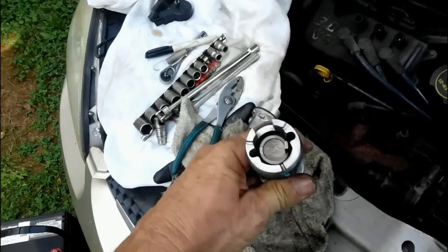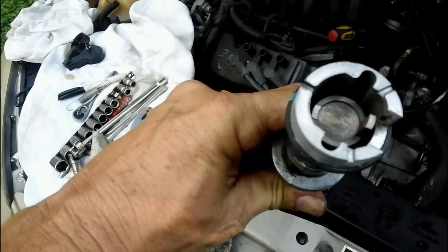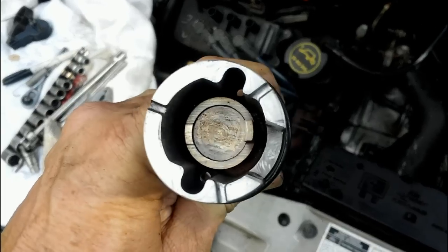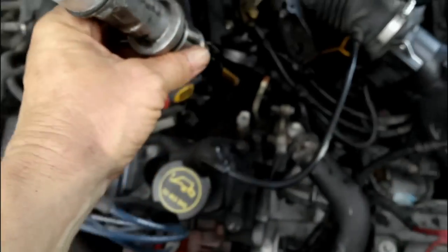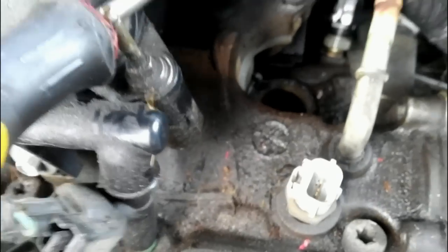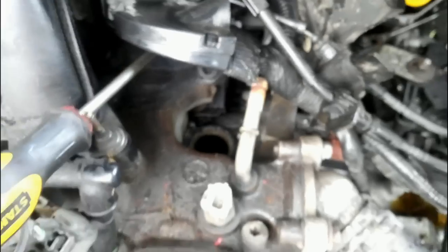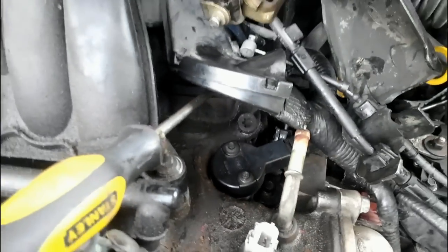I noticed when I put this one in, the mark — before I drop it down in there — right when I pulled this up out of there, that mark went to right about there. So when I push it in, it should slowly go back right about there, right where I want it. It should be in time, and all I have to do is make some minor adjustments. There's the hole down in there — make sure it's pretty clean and don't drop any tools in there. I got it in — it's right where it should be. Don't forget to hook your wire back on.